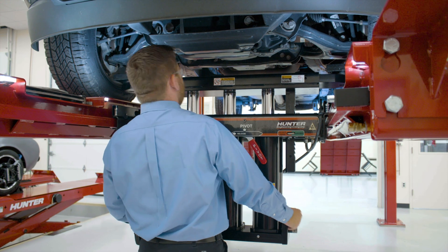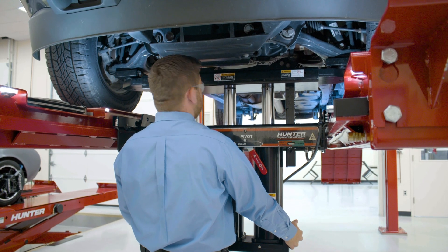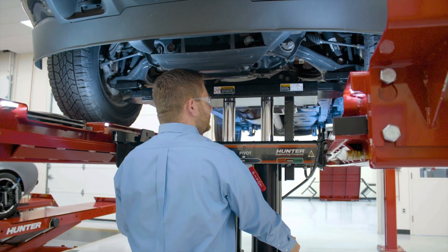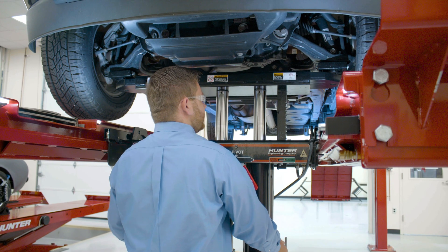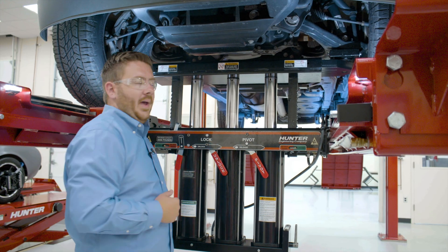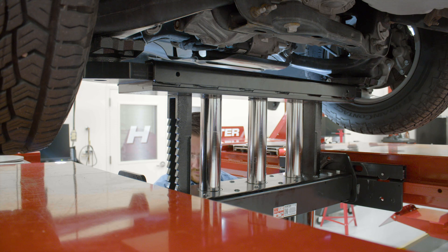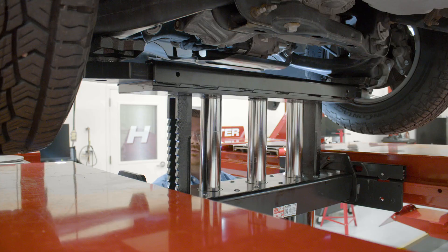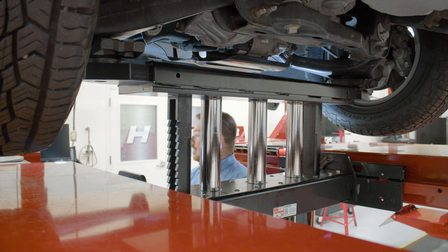Once I'm happy with that position, I'll go ahead and raise the working beam. As it comes up, you'll also hear a set of locks clicking on this jack. Just like with the full-size lift, we want to make sure that when we have the vehicle up in the air, we set the vehicle back down onto the locks for this swing air jack. We grab both of our lower handles down here on the bottom and pull towards us. You'll see the vehicle come down slightly and engage those locks. At this point, the vehicle is sitting mechanically on the locks and there's really no risk of it coming back down any lower than this.